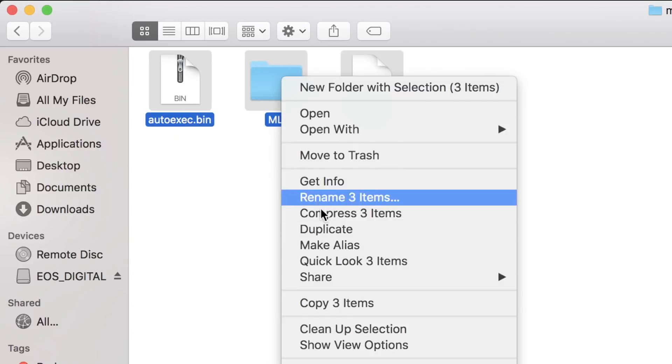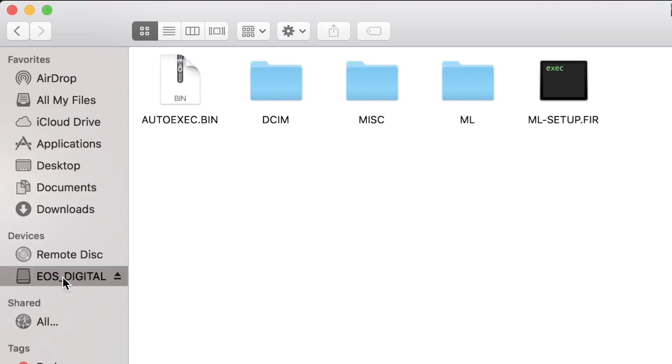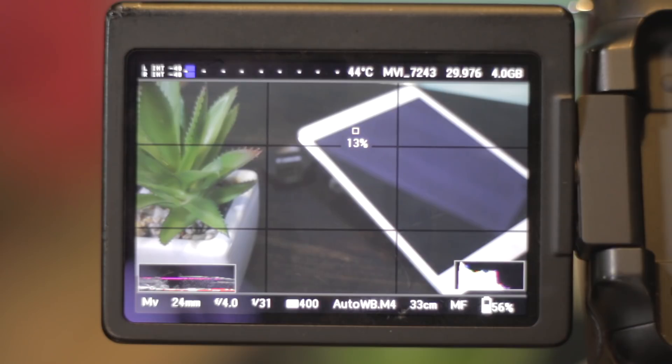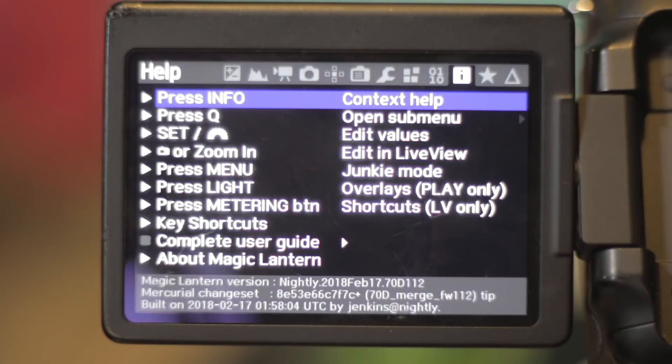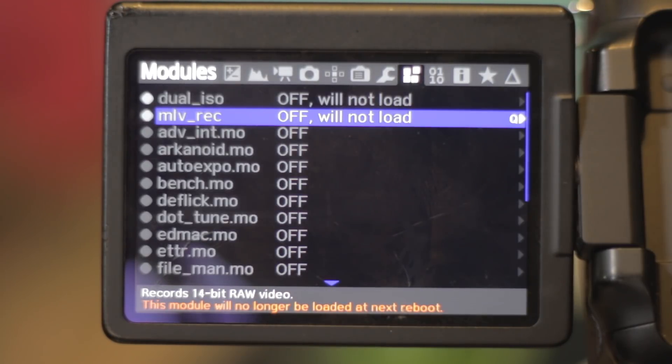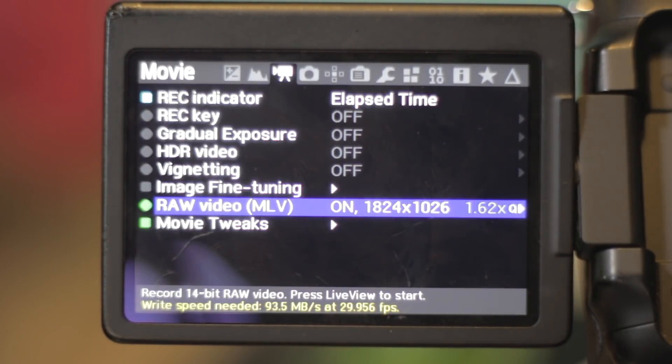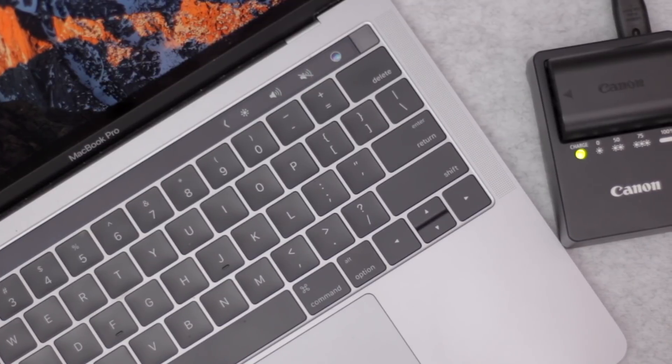Copy the firmware files onto your DSLR's SD card and install it from the settings menu. The great part about Magic Lantern is that it doesn't override the stock firmware — it runs in parallel to it. Once installed, open up the Magic Lantern settings through the trash button and load the RAW recording feature from the module settings. Note that shooting RAW requires a really fast SD card for full HD recording, and a powerful computer to process and edit the footage. A word of caution: using firmware like Magic Lantern will void your camera warranty, so proceed at your own risk.